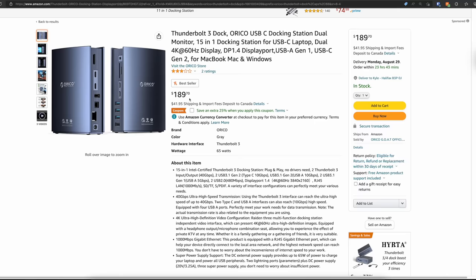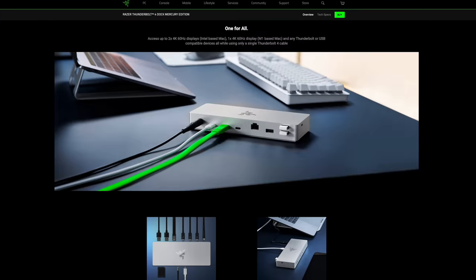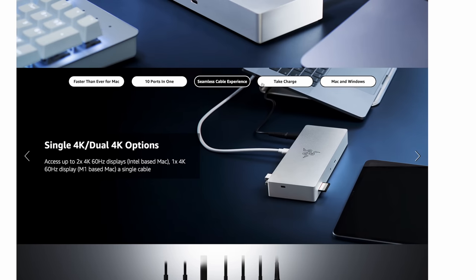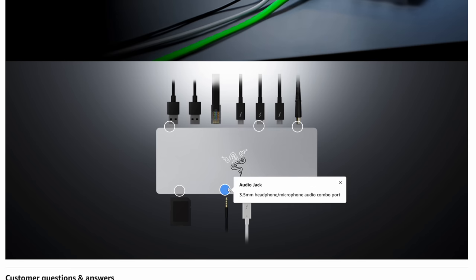If that isn't good enough and you're looking for the cream of the crop and really want to future-proof your setup, I'd probably look at the Razer Thunderbolt 4 dock. Full disclosure, I don't have one personally, but I know some folks who do and I asked them a bunch of questions in preparation for this video — the response I got is resoundingly positive. I know people who have been looking to power multiple high-res displays, and this was the only hub that actually worked properly for that use case. You have four Thunderbolt 4 ports, three USB-A ports with 10 gigabit transfer speeds, and a UHS-II SD card reader, coming in at $329 — which I know is expensive, but probably worth it if you want a premium dock.